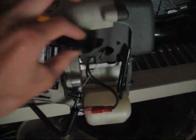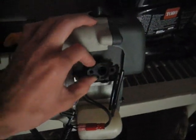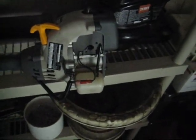See the two bolt holes there — how they're diagonal? I've never seen anything quite that stupid. I don't know why they didn't just put the bolt holes on either side of the port and run the bolts through the carburetor. Instead they decided to put this plastic thing here — it's a little heat dam. It bolts to the cylinder, and then you bolt the carburetor to it. Well, that's dumb. See this thing? It's all cracked to hell. It's never gonna work like that. The person must have dropped the string trimmer on the carburetor or the air filter or whatever, and just snapped this thing.